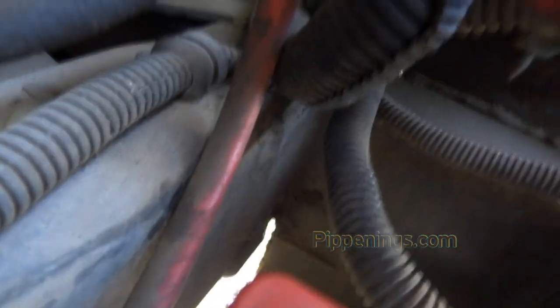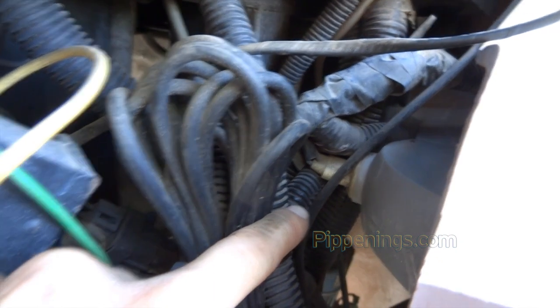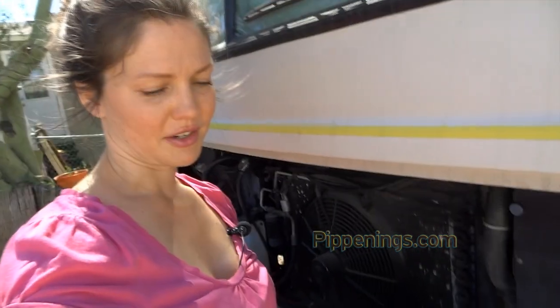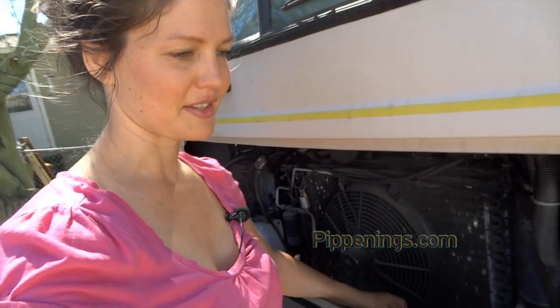They both go underneath here. So I'm going to have to get under the RV and see if I can see where they're going underneath here and then probably coming out over here. I traced this littler one back here and up here, and I just cannot get farther back. I'm going to assume that it is not going to the generator. Worst case, if it goes to the generator and I have it hooked up here with an extension to the new batteries, then it might not get enough power. If that happens, I can come and reassess if I need to do some rewiring over here.